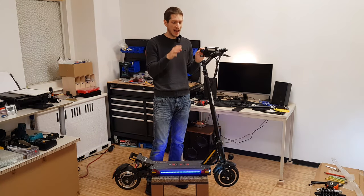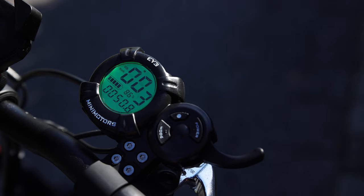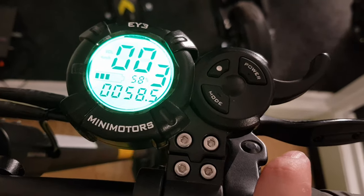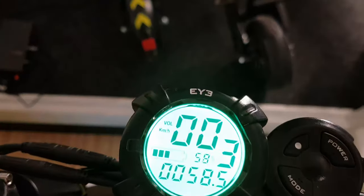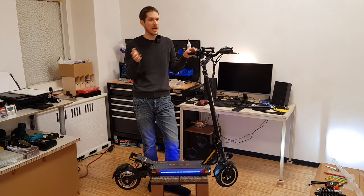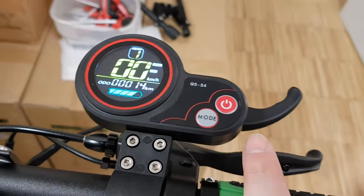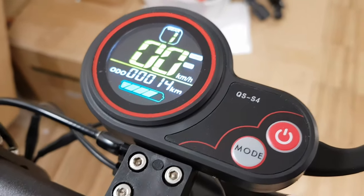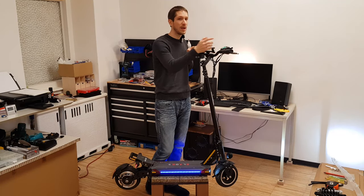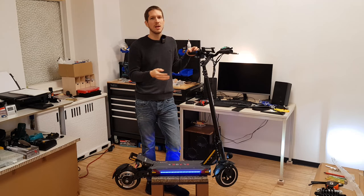What I really like is the Mini Motors display. It looks a little old-fashioned — it's a normal LCD display with a green backlight — but it's so much easier to read in sunlight. The old LCD technology can be read in any brightness, even in total darkness. The modern OLED displays are much harder to read because they have to generate their own brightness to compete with the sun. With the LCD, the screen is black, so whether the sun is very bright or it's totally dark, it reads exactly the same.